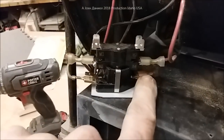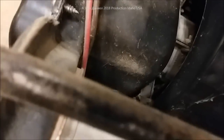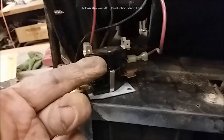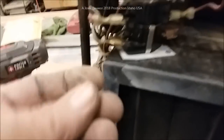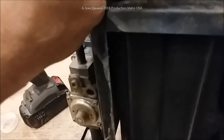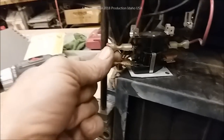Once I've got this hooked up, you can see in here: there is the thermostat wire, the ground wire, the wire from power, and the wire going back to the fan motor. What you've achieved is a replacement using modern or more adaptable parts. The original came with two screws slip-fit. I'm just going to find one of the little holes from the original screws and put one screw back in it — it will not go anywhere, and it's perfectly isolated as it sits.